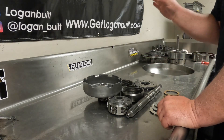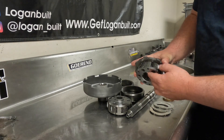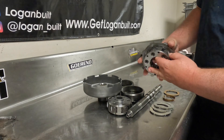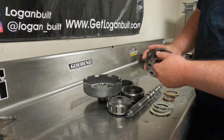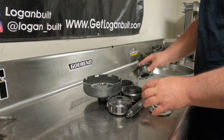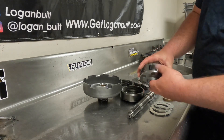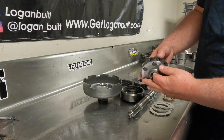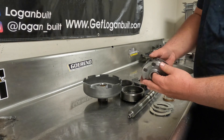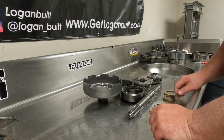We'll start off by making sure that everything is good and clean. As always, we're going to check our planetary gears and check the rollers. Make sure everything's rolling freely and that none of these have an excessive amount of slop. Same for the front planetary gear here. Make sure that we don't see anything jumping out at us, like a broken tooth or anything like that. Once you've confirmed that these are all good to go, now we can start assembling.